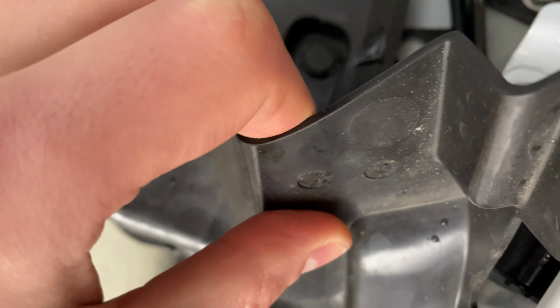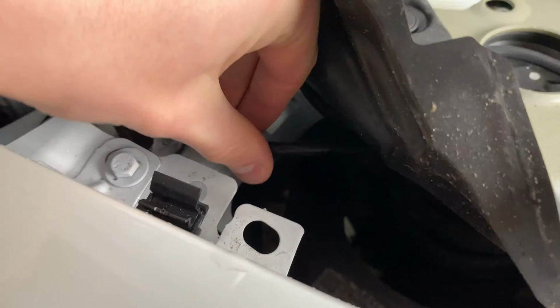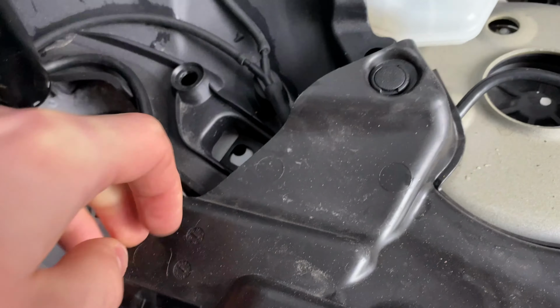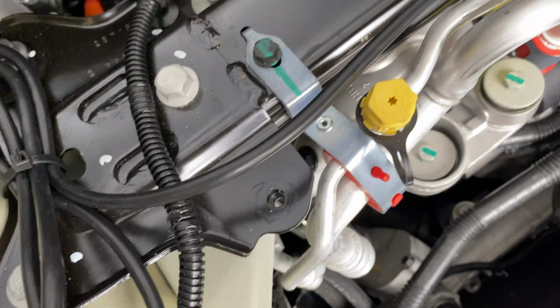Now you can start connecting all of your cables to the control unit. You'll have to route the strut cables under the protective rubber layers on either side of the frunk area. For the right side strut, you'll have to route the cable over the center supporting metal bar and secure it with some cable ties.